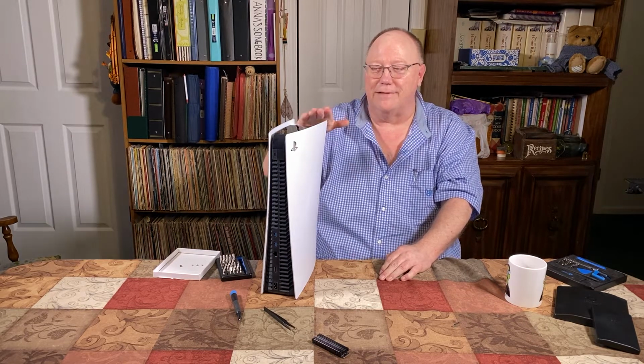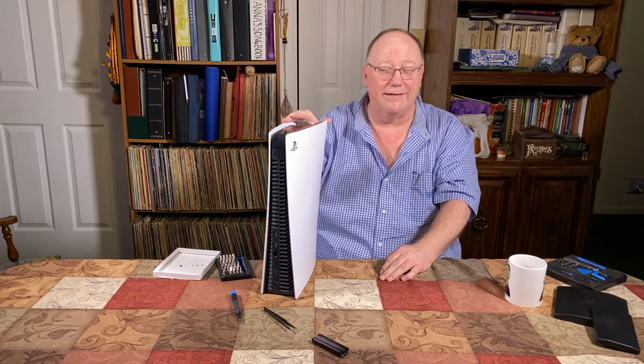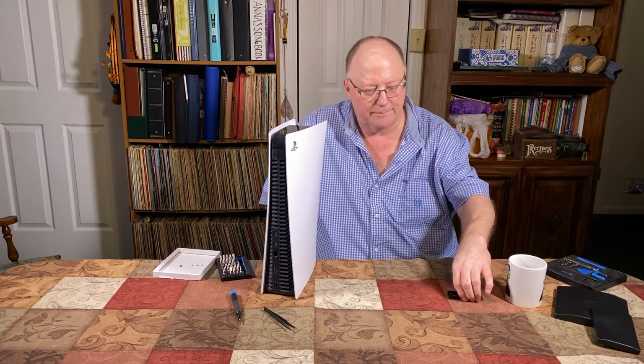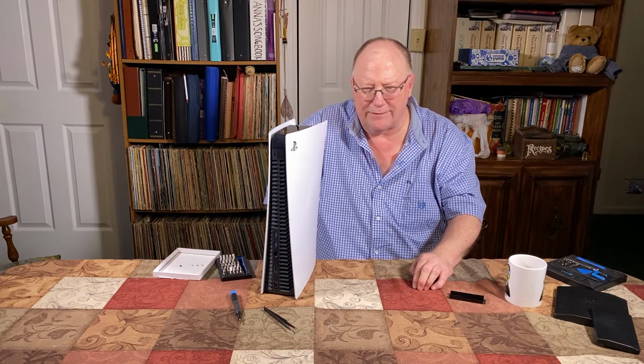I'll leave a link to a really good video on if you really want to dig into buying an M.2 drive. First of all, it has to be an NVMe drive. It has to be generation 4. I can't remember the speed, 7,000 megabytes a second, something like that. Anyhow, I'll have a link to a video that really explains it.